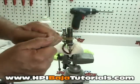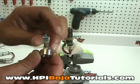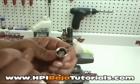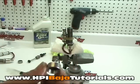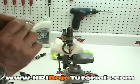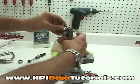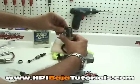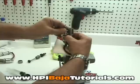Before you get started, make sure that the screw in the top is pretty much even with the inside of the cap. Go ahead and loosen that screw up — you don't have to take it out, just loosen it. Then set the cap down over the spring and the second piston, push down on it, and go ahead and start the threads on it by hand.